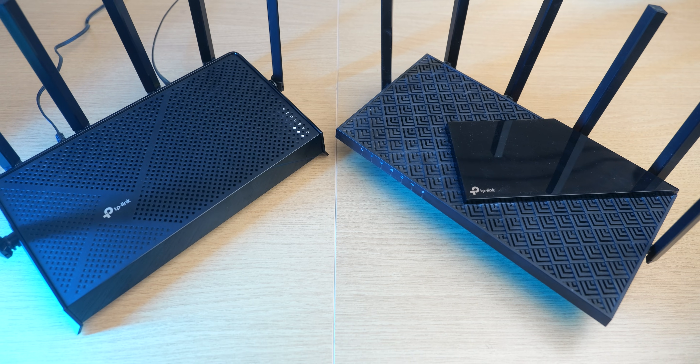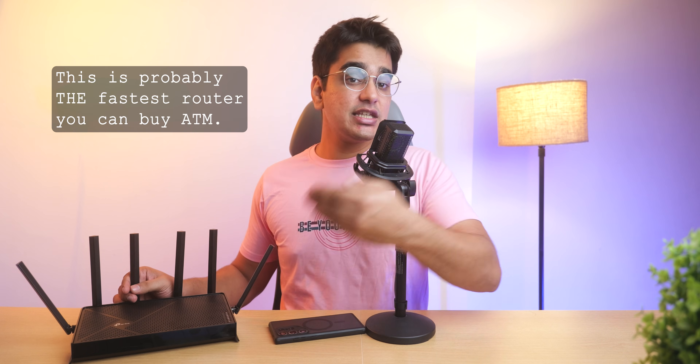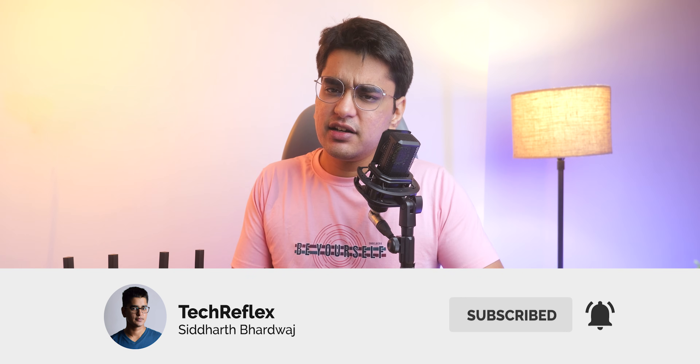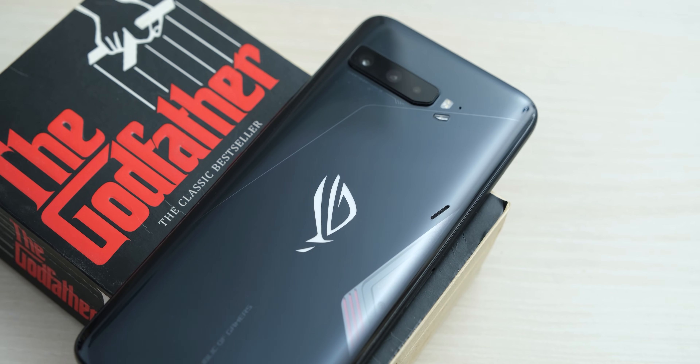Even though this is only a dual band router, you are going to get speeds much better than Wi-Fi 6 routers in its price range, and if you are in countries like India, this is easily one of the fastest routers you can get. Speed tests were taken with a Samsung S24 Ultra, which is a 2x2 Wi-Fi 7 client. On 5 GHz without MLO, I got 1500 Mbps while keeping the phone very close to the router. This really shows the improvement Wi-Fi 7 can bring — with a Wi-Fi 6 phone I got 917 Mbps for the same test, so this is more than a 50% improvement for the same price.